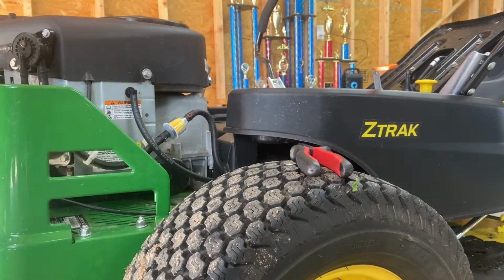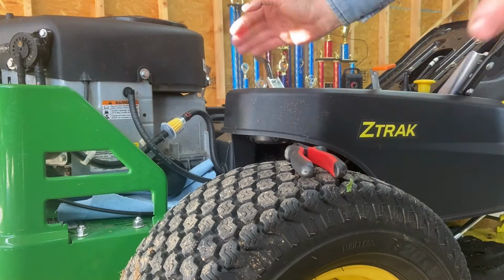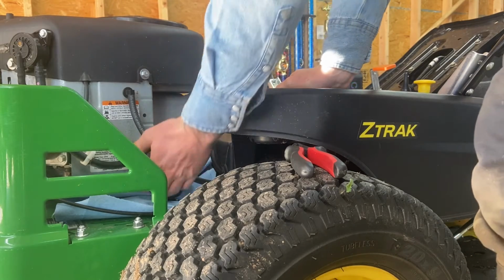That, and then we'll pull the oil filter off. Make sure you put a rag. There's not a lot of oil that comes out, but I would put a rag right here to catch whatever excess oil comes out when you pull your filter off. You don't want to make a mess, and always do hand tight. There's no reason to put a pair of pliers on it and over tighten it, or you'll be beating it off with a hammer or something when you go to change it next time.